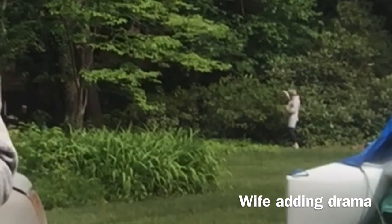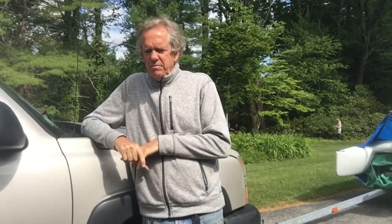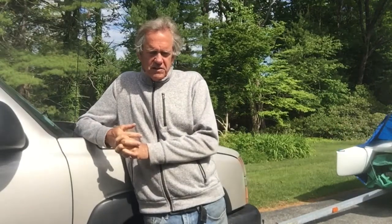So the faster the wheels were spinning, the higher the pitch of the growling. It would kick in about 10 miles an hour and continue up to about 40 or 50 miles an hour, and then it would kind of go away. But I had recently had problems with U-joints, and I take long trips, so I was nervous that a noise like that might cause a failure while I was on one of my trips. So I decided to try to fix it.